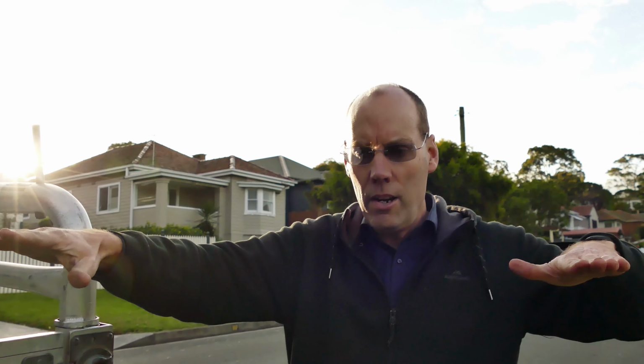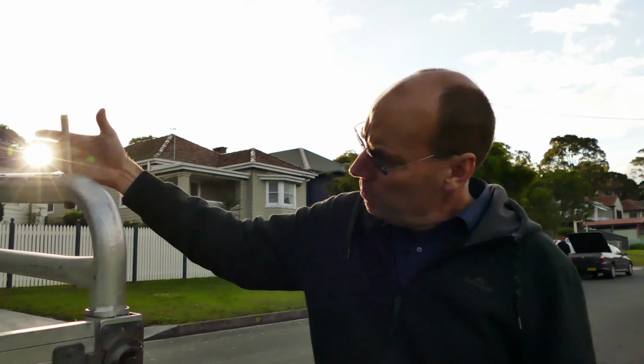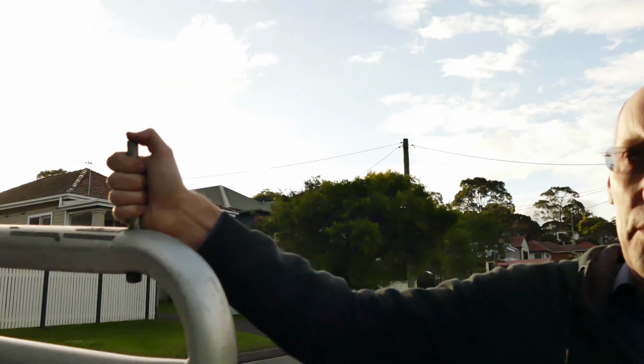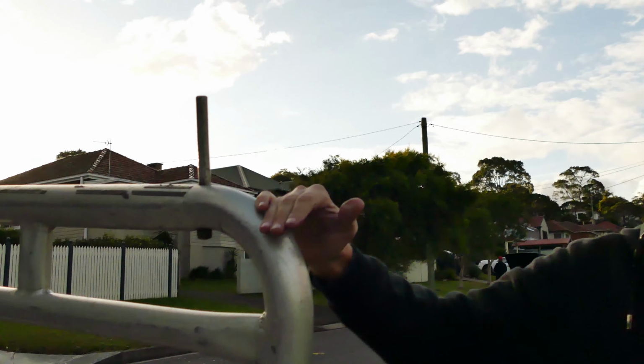If you just carry things in a flat load like that, the middle ones won't have any pressure on them from the strapping and they could fall out. So just be aware of that. Also, butt it up against these side pegs so that they don't slide off. Don't carry anything outside that peg.